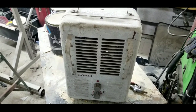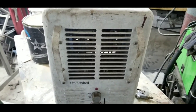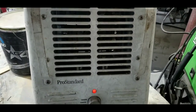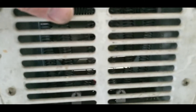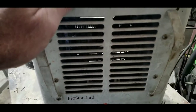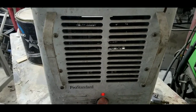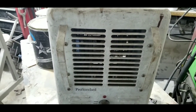Make sure it's unplugged first. I'm gonna show you what it's doing before I unplug it. I'm turning it on and you hear the hum, but see that fan back there is not moving. So it's heating up the elements, and if I just leave it on like that it'll probably burn them up. It needs the fan blowing through it to keep the elements from overheating. I'll turn that back off — it is getting warm but there's no air coming through.